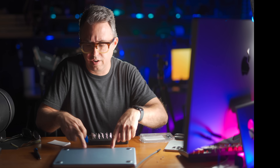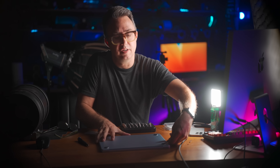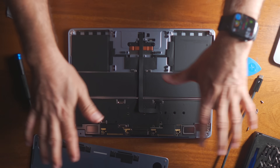I'm going to use this little guitar pick-like thing to pop up — I think there are six tabs holding this thing down, definitely two in the front. That's the winning corner. You'll run one of these along the side — it's a little scary, it's your computer, but you're going to hear some pops. You can just work it around and you're going to hear some more. The most important thing after that: you cannot just pull this off the bottom. You need to get a hold of it and slide it. This is the hinge side, so you need to slide the bottom away from the hinge. There are these little grabby arms on the bottom holding onto it, and it takes a bit more force than you might be comfortable with.